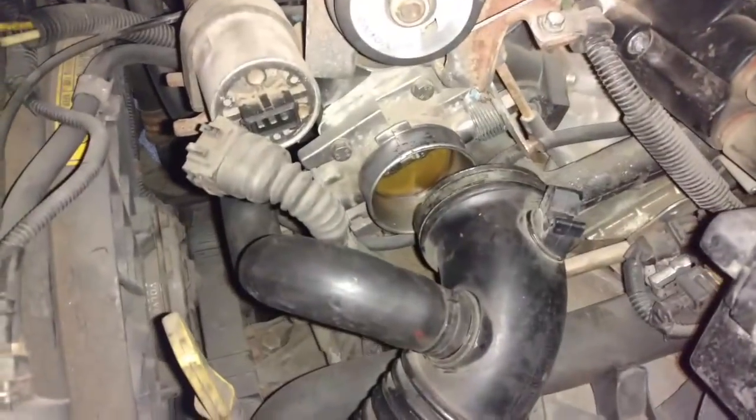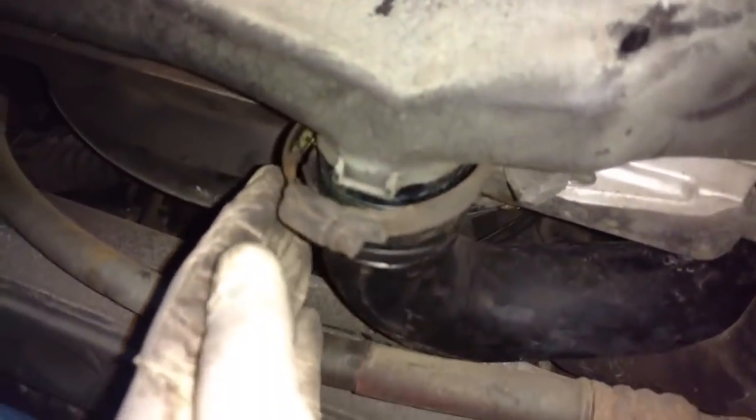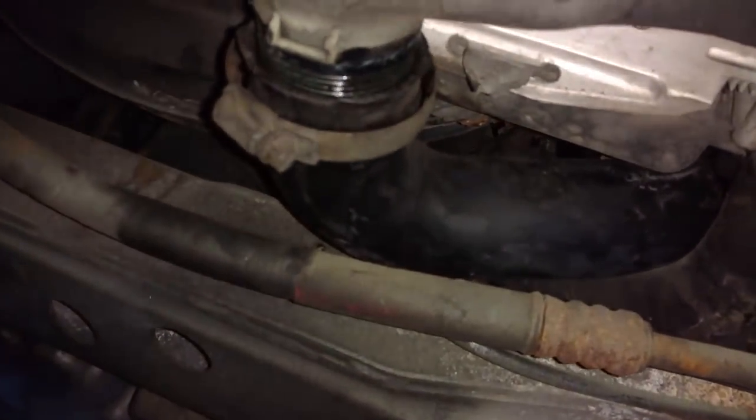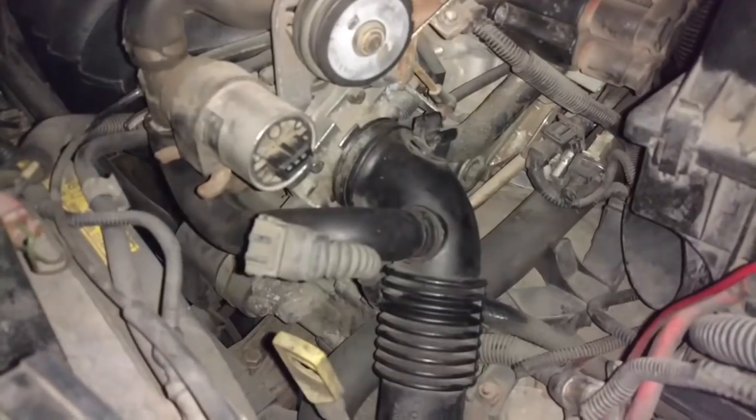In front of the throttle body there, maneuvered it down there. Now I'm going to go down there and connect the bottom pipe first. It's up really good down here. So let me get this clamp beside it, fit it over the intercooler, and then get this clamp on there, bottom of the intercooler. Fit it in place, and now I'm going to tighten all three of these clamps.